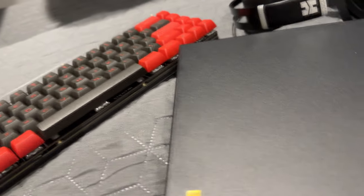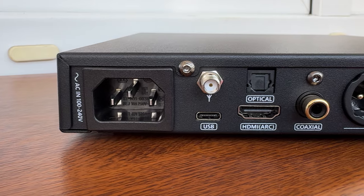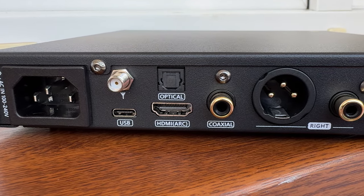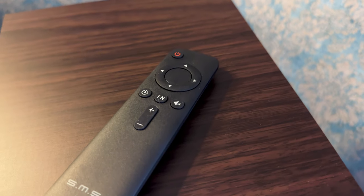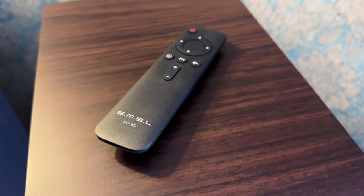The differences between all filters can be subtle, but I can hear them. By far the most interesting one is the non-oversampling filter. It's not running your DAC in a real NOS mode, as it's not an R2R DAC. However, what it does is quite simple: it purposefully doesn't cut down any top-end frequencies, which is perfect for signal phase. This filter is perfect for extremely well-recorded music, but for everything else it's probably the worst — it unmasks unpleasant issues in a very obvious way. My recommendation would be to use a slow and phase-compensated filter, which is the next best thing and doesn't mess up songs as much when they aren't perfect. And trust me, most songs are not perfect.